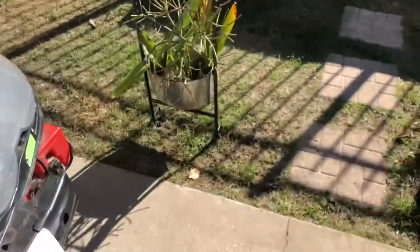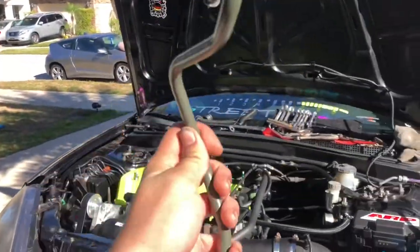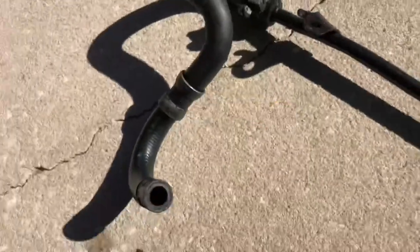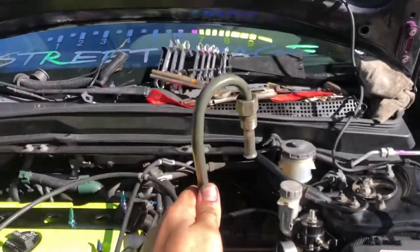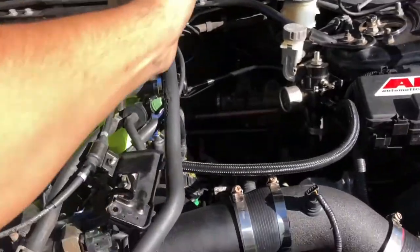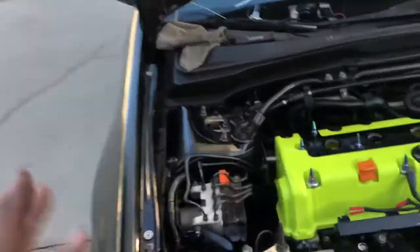I ran into not an issue but a bump. On one of the return lines you have this fitting right here and it's definitely not a 6AN fitting — it's like an 8 or a 10. I went back and studied the hose so it goes from soft to hard, so I'd be able to take the hard line, push in the steel braided line, and then put the push-on hose. What I have now is a modified hard line that's gonna mount just like this, and then I'll have this bendy piece to flow right back into the rack. I already have my fitting there with a little rubber piece from an injector, so I'm gonna throw this on and see how she feels.